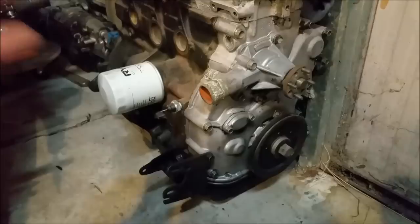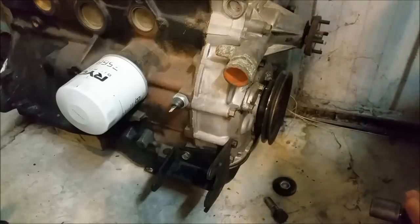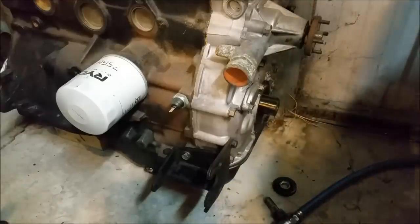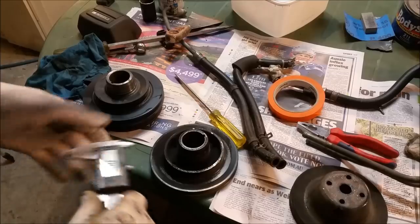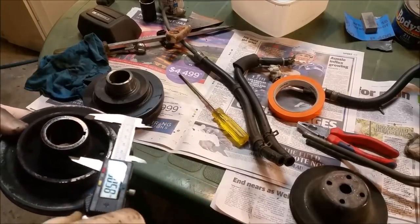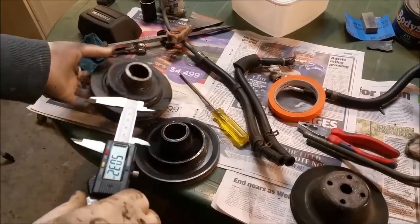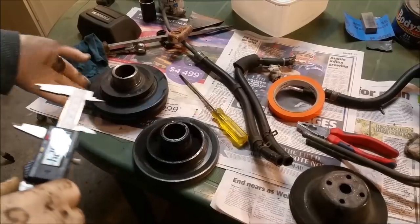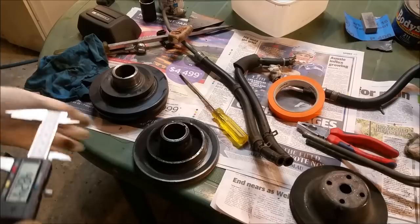A bit of sad news - I've had to pull the pin on the 2.6 engine. There's a GK one, therefore a wide block because it's manual, and mine is a narrow block, therefore the gearbox won't fit. Some people on forums say the tunnel has to be modified and I'm just not going there - I'm not doing that to this car, I've already started putting it together. There's also a shifter problem in that the earlier ones have the shifter further forward where the later ones have it further back.